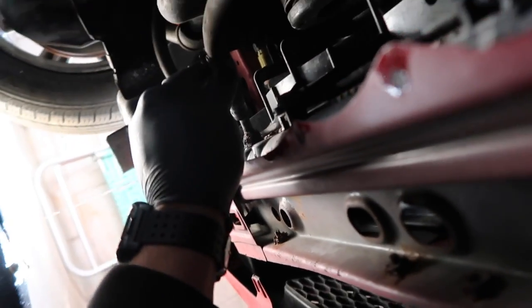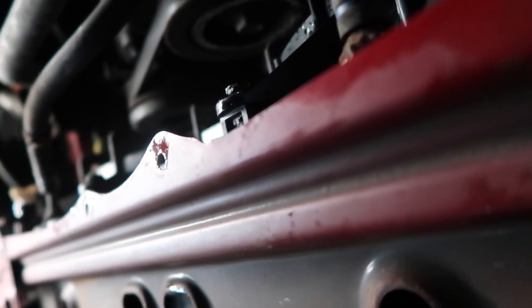So we took the plate off. We are now draining it from the drain. It's taking forever. We loosen the transmission line, which is here. We got to pull that off. Then we loosen this one, and we got to also pull that off. I wish it would focus. And then we took the clamp off of the bottom radiator hose, which I should just pull off, but I'm trying to teach them right. Unclamp the temperature sensor, I'm guessing. It goes right here. And that's basically it for the bottom. So he's still working on the top.